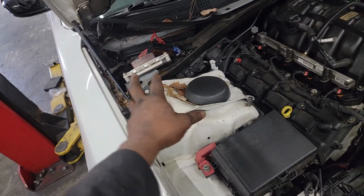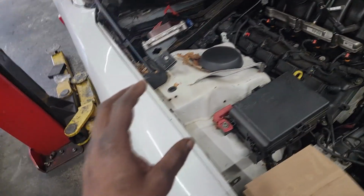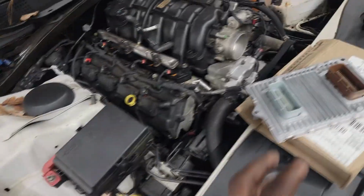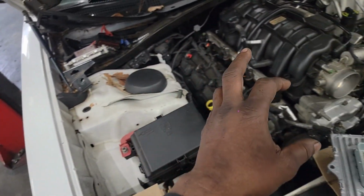Now some would say, why can't you just program that one? That one has, in my opinion, based off my diagnosis, an internal driver failure. The driver is commanding the ASD to be on at all times. Now you know what I wanted to do? I wanted to make sure, in fact, I got a little time. I'm finna plug this up. I wanted to look at some inputs.